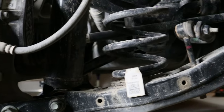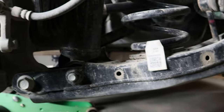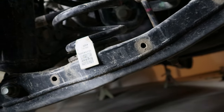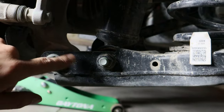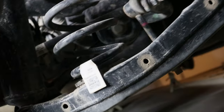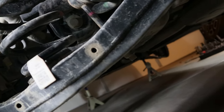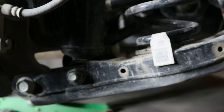For the backside it's really nice to get that spring in — already did that side, but this one is super simple compared to the front. This bolt, this bolt, and your sway bar nut right there — these are 19 millimeter each, so you'll need a wrench and a socket. The sway bar link is a 17, and it just comes out easily. The whole arm will actually swing down out of the way.